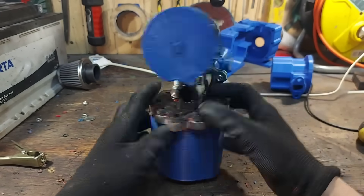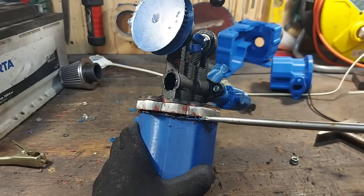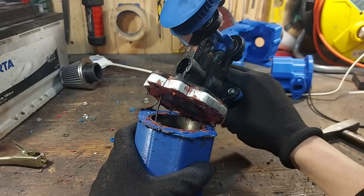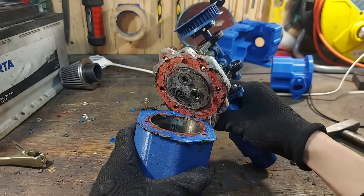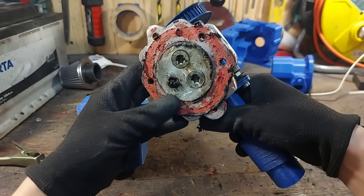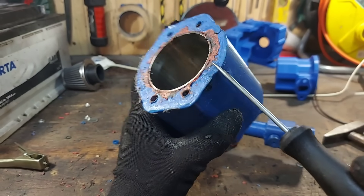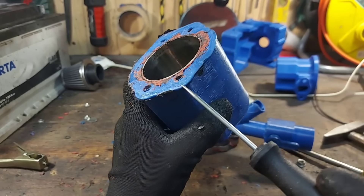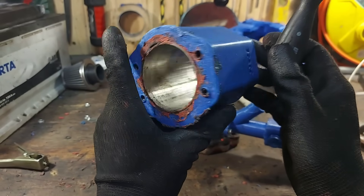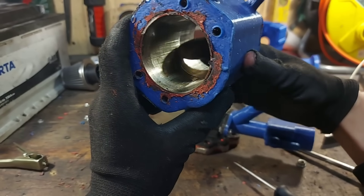Let's keep digging. This black gooey layer is all over the insides of the engine and most likely came from the piston. The cylinder body had a hard time holding on and started melting in places. The cylinder has some scores, but because I cannot feel them with my nail, I'm most likely going to reuse it.